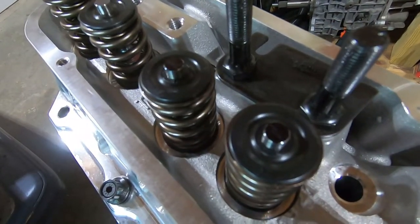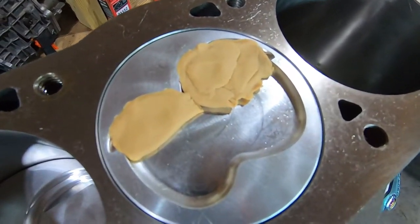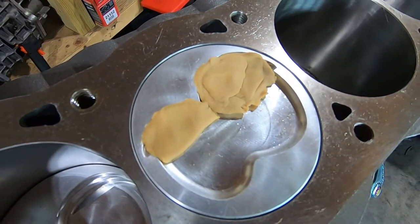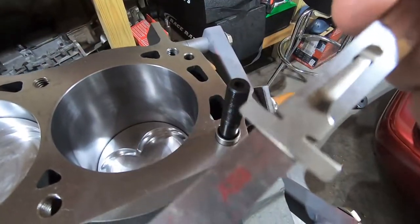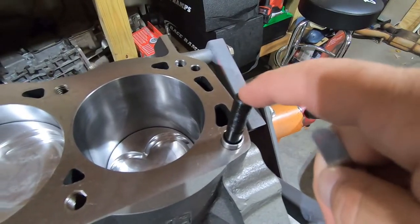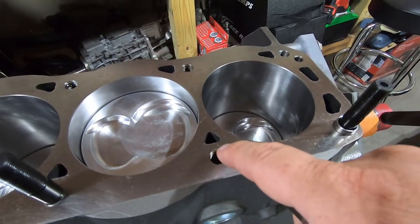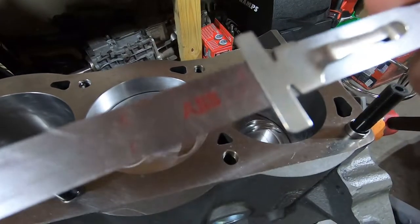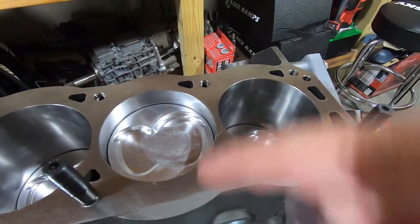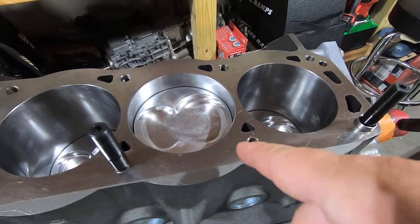Good news — plenty of clearance. The valves didn't even touch the clay, so nothing but clearance. It turns out that two and a sixteenth is what the lower studs require. I'll take those washers, stack them up in there, and run the stud in until I get two and a sixteenths. This is just for the lowers — the uppers are fine — and I'll do that for both sides since the heads are identical.